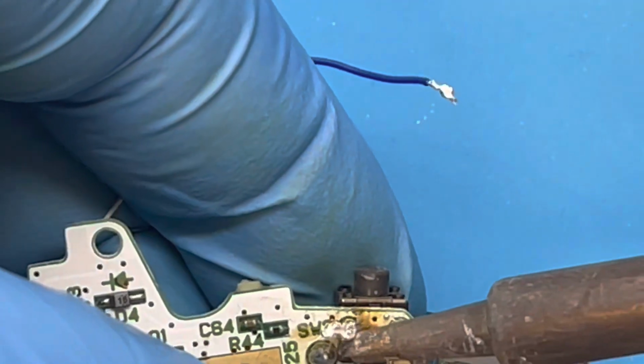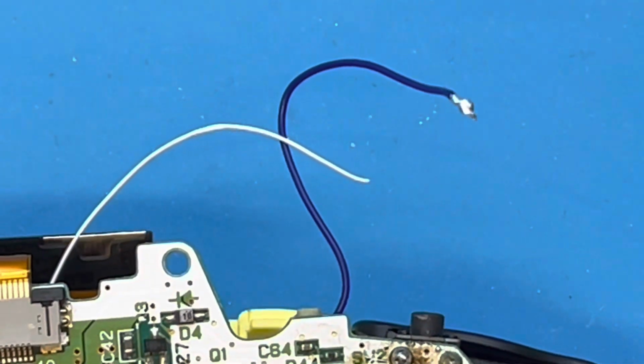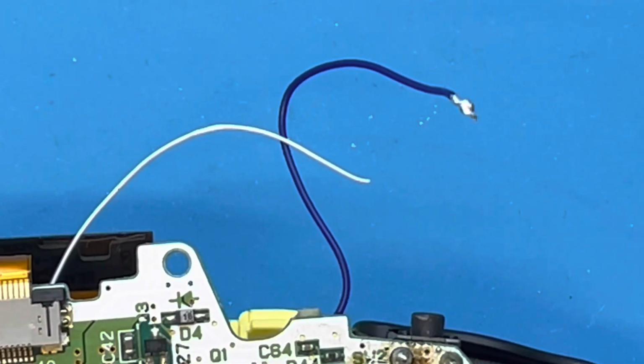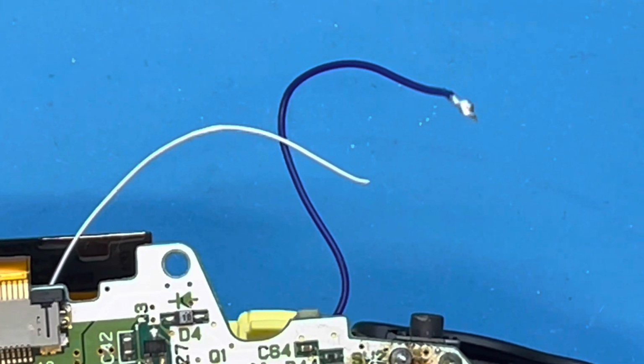And even today, I still made a mistake by not cleaning it off before I started. I should have cleaned that old burnt flux off this board ahead of time, but I didn't. And was trying to do it as I go, and it led to an ugly chain of events, which you will see in this video.